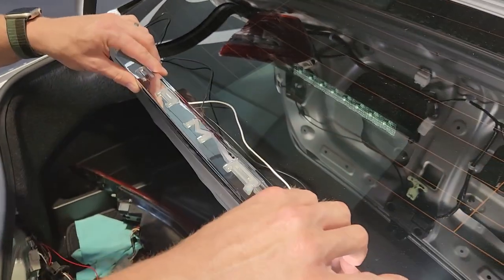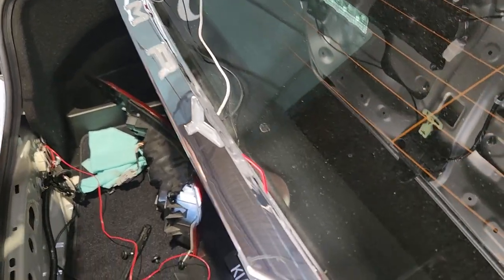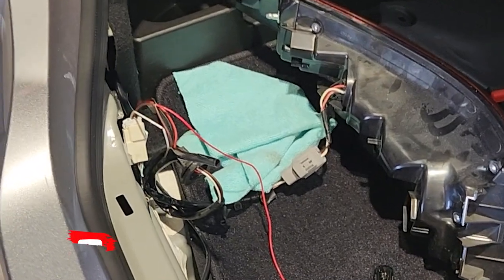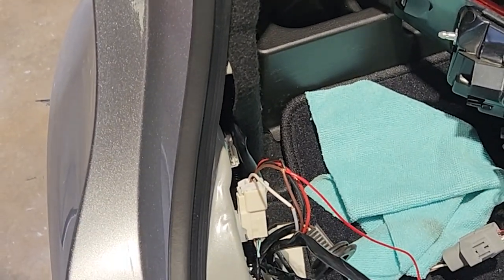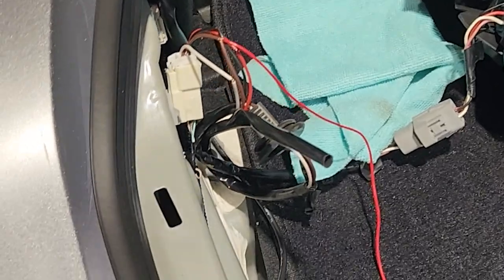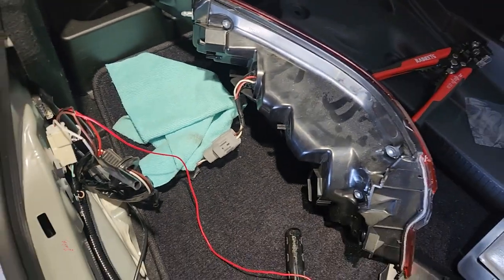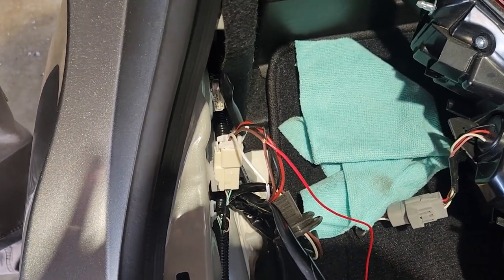The white wire has a startup animation for the running light. Right off the back when you open the package you will see these three wires — the red wire is longer, as you can see, and it's run pretty much all the way across. So the red wire needs to be connected to the brake light. On the XSE, you have to locate the brake wire on the tail light. On ours, the brake wire is brown — it may be red or another color on yours, but on our aftermarket tail light for the XSE it's brown. So we connected the red wire to the brown wire on the tail light.